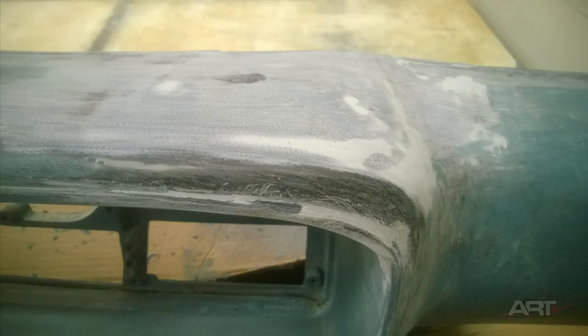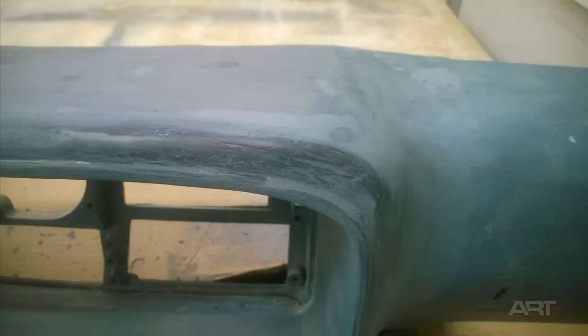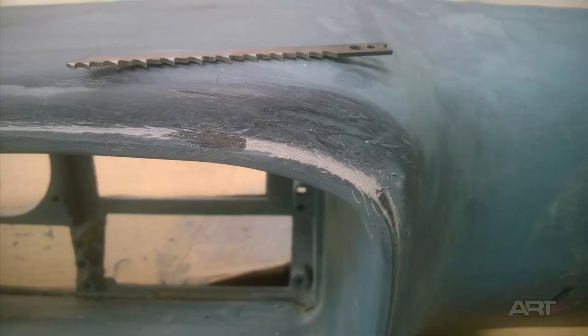You can use 100 grit at first, and then feather with 220. This feathers extremely well, especially so if put over a rough-sanded surface. Wiping on a bit of color will help you to see what you have so far. To get this border ridgeline contoured just right, I found the best tool for that happened to be a jigsaw blade.